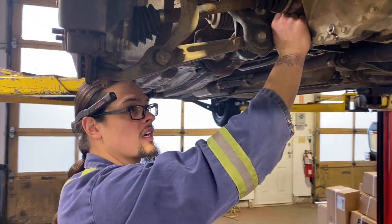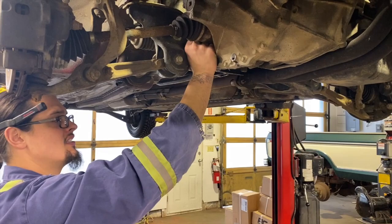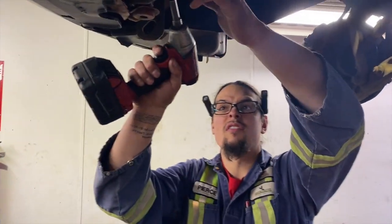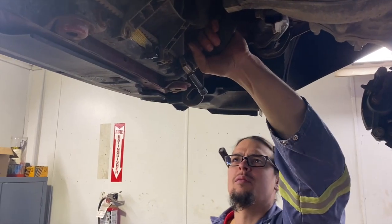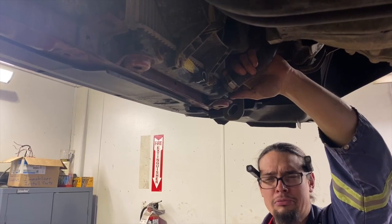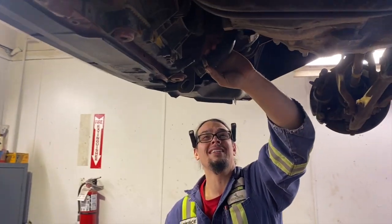Now we're just gonna plug up all of our holes so that we're not leaking fluid when the engine's sitting wherever it's gonna be sitting. Just gonna pull off the lower rad hose. You can't get any more coolant out of here. Oh, there's the nice socket. Dry as a bone. Dry as a bone.